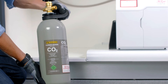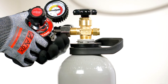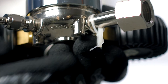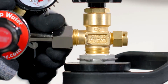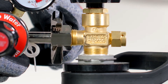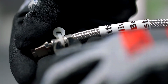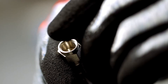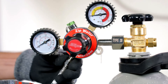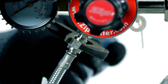As these are sparkling models, you'll need to fit a CO2 bottle to the unit. The regulator needs to be fitted to the bottle. The regulator should have a washer pre-fitted to it and a spare washer cable tied to the regulator. Do the regulator up finger tight and then use your shifting spanner to make that nice and tight. The securing olive is cable tied to the braided hose — just cut the cable tie and fit the olive into the end of the CO2 hose. Then take the CO2 braided hose and connect it to the bottom of the regulator. Tighten the connection finger tight and then the last quarter to half a turn with a shifting spanner.